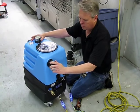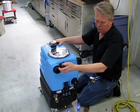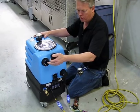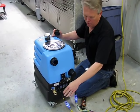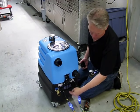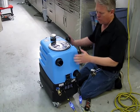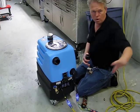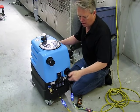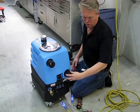On the top end there's also another connection here for you to use. You can either hook your current machine to this part here or to this part here. If you're going to hook it to the top then you're going to use the auto pump out feature, because as the water is falling into this unit you can turn the switch on for the auto pump out and it will pump the water as it's falling into this tank. But if you want this to remain dry and you want all your water to go to your existing machine, then you're going to cap this one off and hook up your machine here, and your regular machine auto pump out system or manual drain would be used.